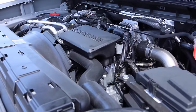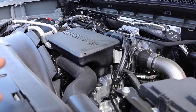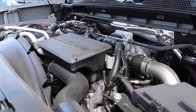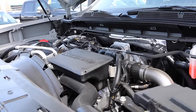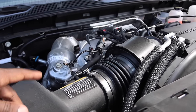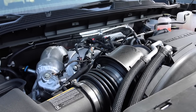The Gen 2 L5P is probably one of my favorite diesels for 2024. The reason is because of the power increase and how it puts that power down, not just towing but unloaded too. 470 horsepower, 975 pound-feet of torque — I think GM was conservative on these numbers. I've had a few videos where this engine outperforms the high-output Power Stroke, and it definitely outperforms the Ram's high output because that engine is just a medium-duty setup with that transmission. This has the stamp-approved Allison, which is a 10-speed, and first, second, and third gears in these transmissions are absolutely deep. I love how this truck puts the power down. 12-inch ring gear on the 3500s, Delphi fuel pump and injectors.